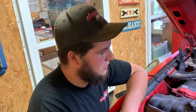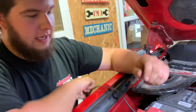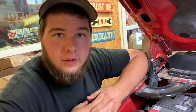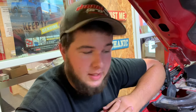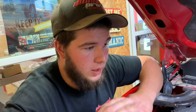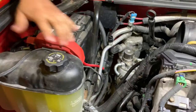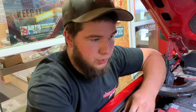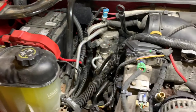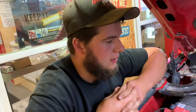You've got a couple different ways of bleeding the fuel system depending on your truck's configuration. If you have a lift pump and your system is dry and your lift pump is primed, the easiest way is just to turn the key on, let it go for maybe 10 to 20 seconds, then crank the engine over. The lift pump will send fuel up to the injection pump and filter housing. The only way to prime the high side is just to crank the engine over.